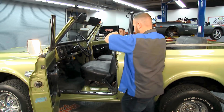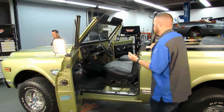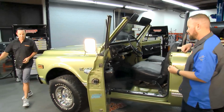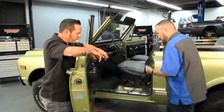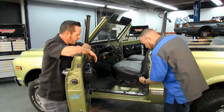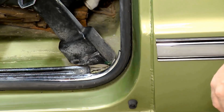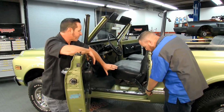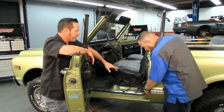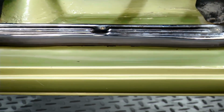So if you swing over this side, if you can swing over my way, because you have a real keen eye, especially for these era trucks, it's the business you guys are in. But one thing that jumped out at you that I thought was interesting, and this is something people can study up on, use the internet and all the photos, but I should be seeing a seam somewhere in here, and I'm not. Right. So what I know about this is that that's a rocker panel replacement, and what they probably did is a hack job, and then they just bondoed in the seam, because normally the rocker panel would be a separate panel from your quarter panel, and you'd be able to see that.